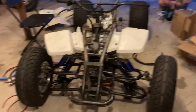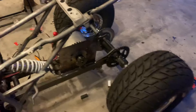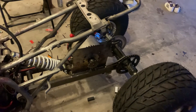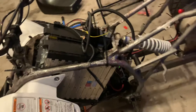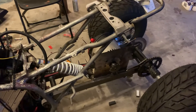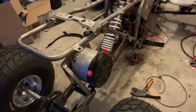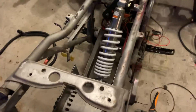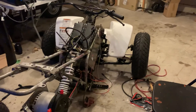This thing should be an absolute beast. I'm trying something different — I'm putting the motor on the swing arm. On most of my motorcycles I've used hub motors because it leaves a lot more room for batteries. I was able to put a huge motor on the back and welded in a support bracket. I had to raise it back to stock in the rear and lowered it three inches in the front. I need a stiffer spring for the back — if anyone knows where to get one I'd greatly appreciate it.